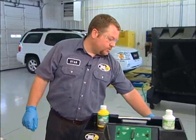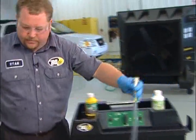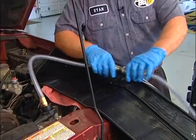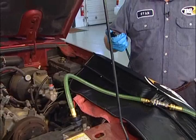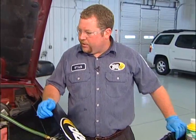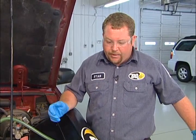It's a small radiator cap, so I'm going to need a small rubber plug. I'm going to hook my service wand up to the radiator opening, then take my service hose up to my service wand. I want to extract once again and turn the vacuum on. I want to run no more than two minutes — at two minutes I'll know the extraction of the old coolant is complete. I also know it's complete when we stop getting old fluid coming out of the system.